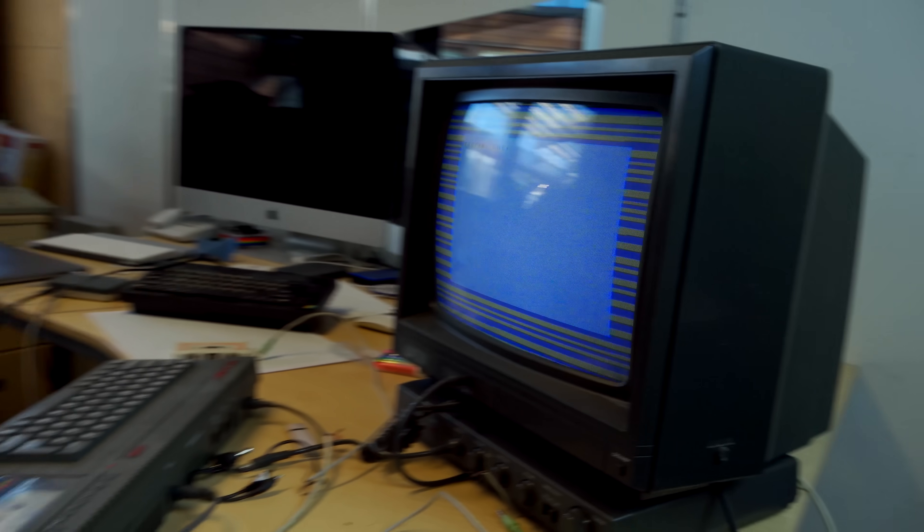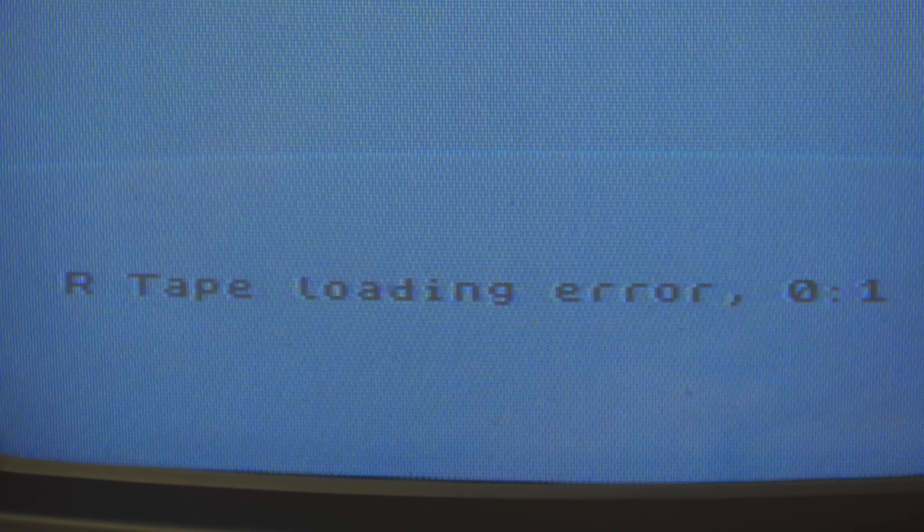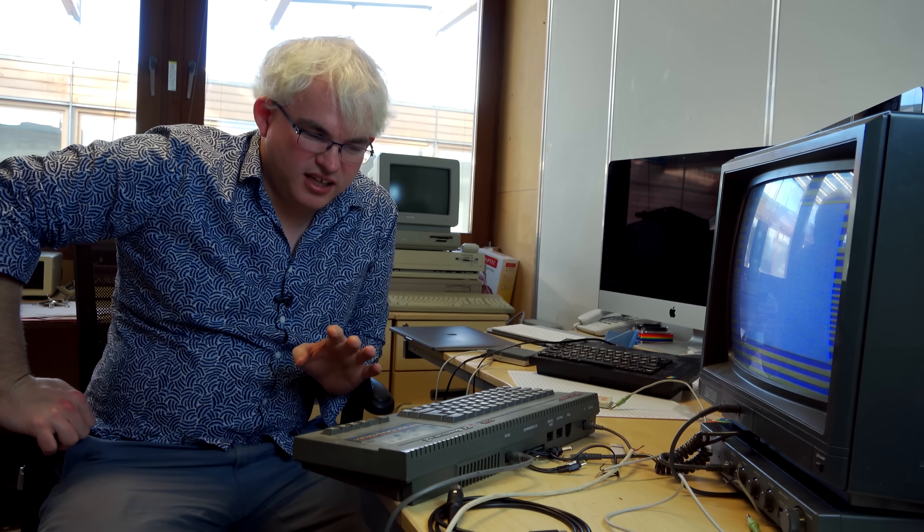So what's actually happening now? Yeah, not a lot. I haven't used this tape in about 30-something years. What do the stripy lines mean? The stripy lines are just a visualization of the data that's coming off. We then get a program title and it's now loading in the program. These stripy lines are a representation of the data as it's being loaded in off the tape — it's what's stored as an audio signal. That noise you can hear is the data, the bits that represent the program, converted into audio tones which are then loaded in by the computer. The program would take a while — probably about three or four minutes. Or more likely if you're using a domestic tape recorder, you'd get to the end and it would say tape loading error, and you'd have to rewind, adjust the volume, and start again.